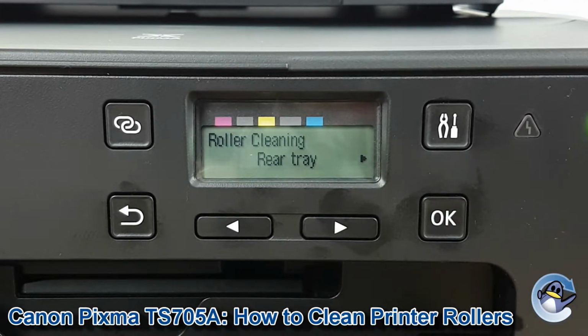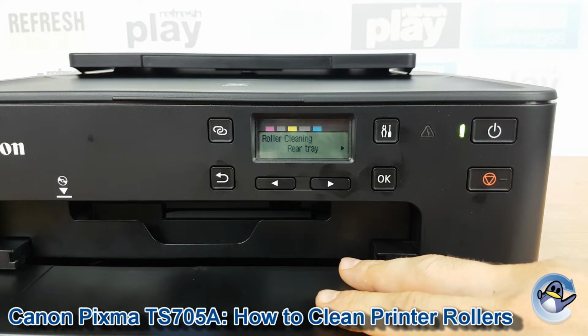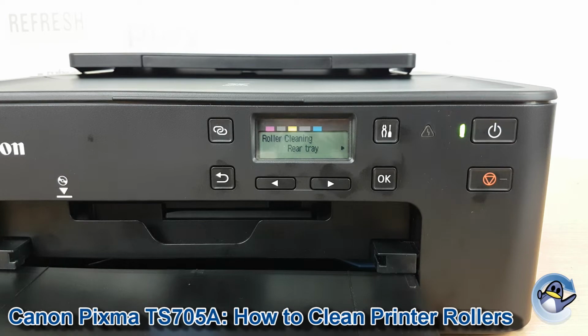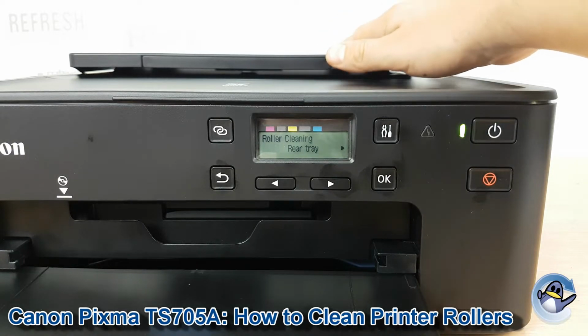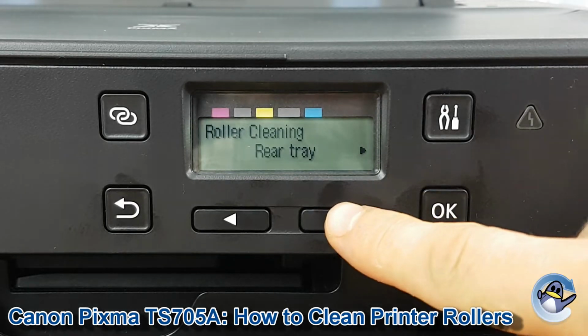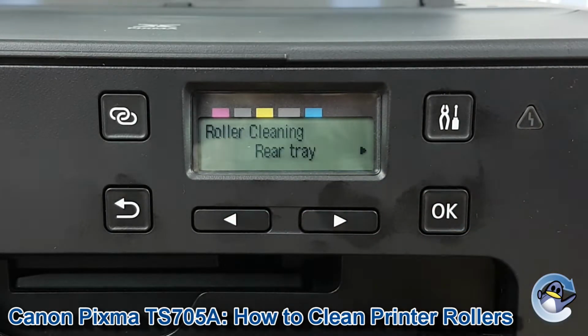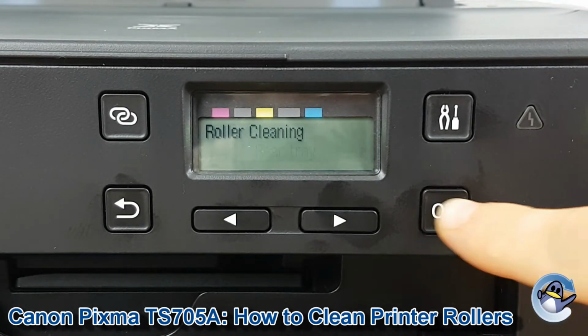Now at this point we need to decide whether we're going to be cleaning the rollers for the cassette or the rear paper tray. Now which one you choose depends upon which one you use the most. For argument's sake, let's say I use the rear tray a lot, so we'll extend that and then select OK. If you wanted to choose the cassette, just press right and it's right there for you to press OK on. So just press OK on rear tray.